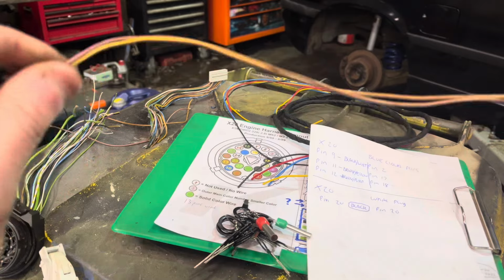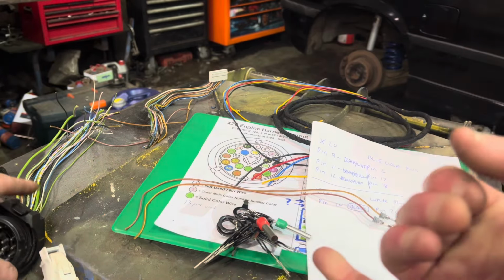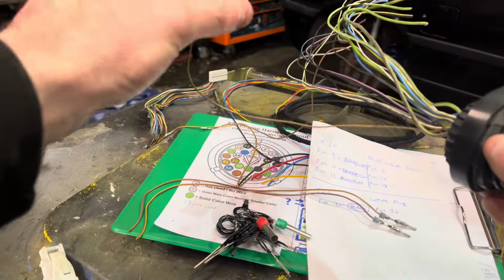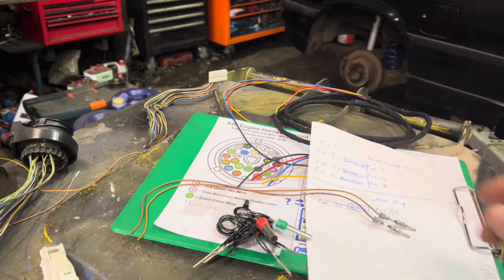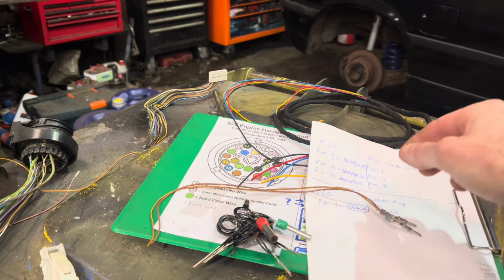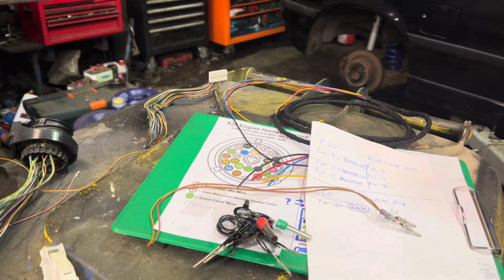Right, so two temp wires. We already have speed signal on the car, on the X20 plug. It has speed signal, but we're going to cut it, and then we're going to tap into our wires. So the wires I'm working with today is a brown yellow for temp earth, a brown purple for temp signal, a straight black for RPM, and your speed signal wire is black with white.